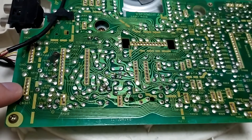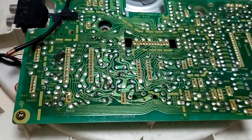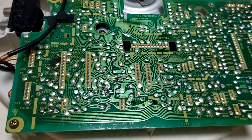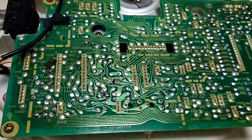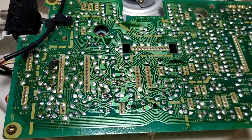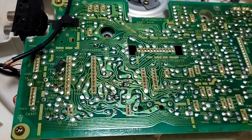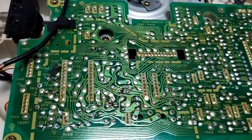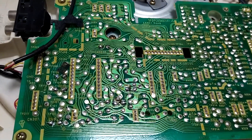So what we're looking for is 1.8 volts when the tone arm is centered, and 3.6 when it's at the full right position. I'm going to figure out how I'm going to hook into that, set up some tripods, and we'll try and go through this procedure so we can actually see what we're doing and you can follow along.